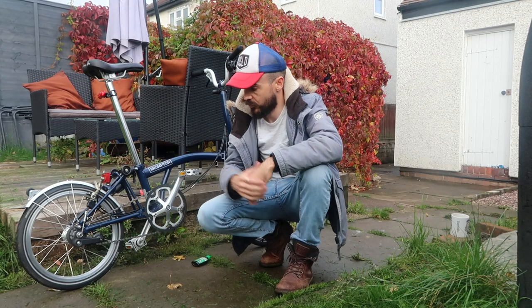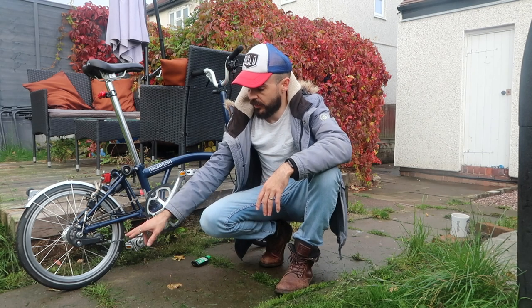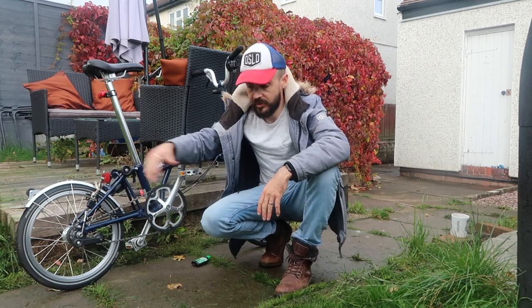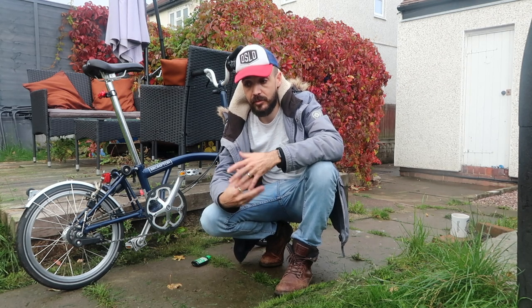The brakes are adjusted and the bike's clean. Every day is clean the bike — just give it a wipe over if it's wet, to save it from going rusty as much as possible. And then the chain and the brakes. I'll do the chain once a week on a Sunday night, and also pump the tyres up to make sure they're 100 psi. With the brakes, do that maybe twice a week. Just make sure that it works. We use our bikes every day — we rely on them a lot, to go to work, go to school, go shopping. You just need to make sure that they're kept maintained and they're going to be good to go straight away as soon as we need them.